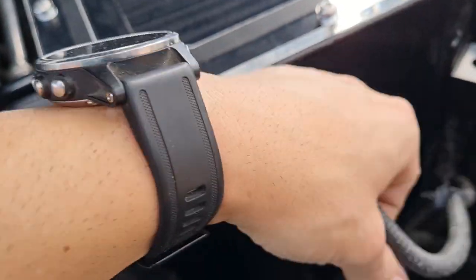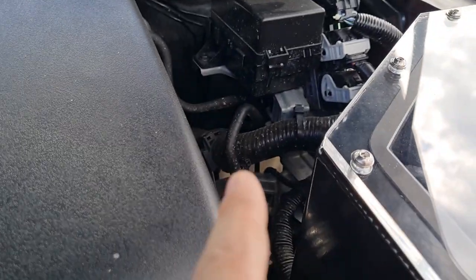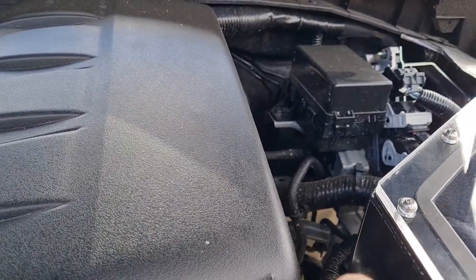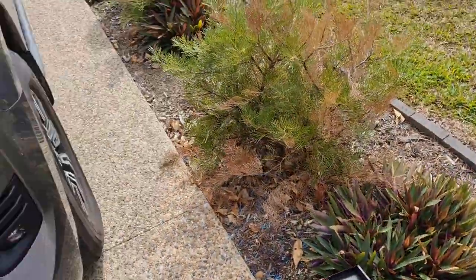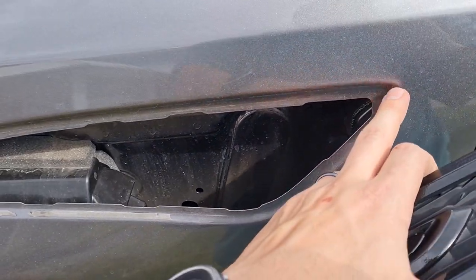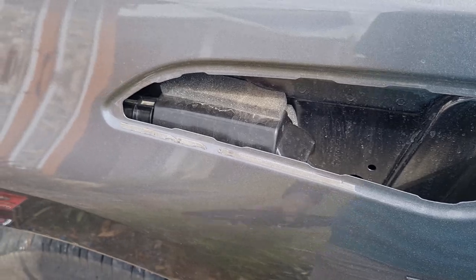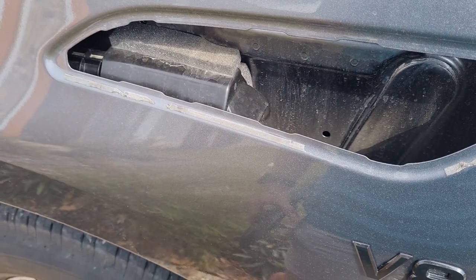We'll still need to route the wiring somewhere - there's plenty of space to cable tie it so it's nice and neat and out of the way. Don't forget about your diff breather either - that'll need to be cable tied somewhere up nice and high. Now it's on to the scary bit where we need to mask up the guard. You'll need to take the patrol garnish off, which is simple enough - it has clips on the inside or you can just pull it from this side and pop it out. That gives you a nice area to cut.